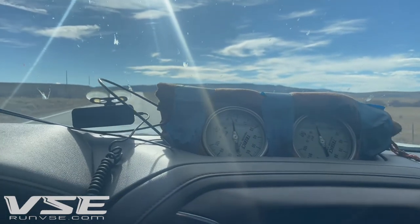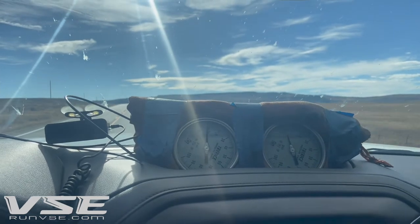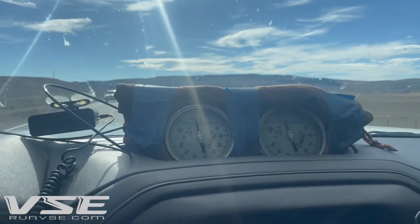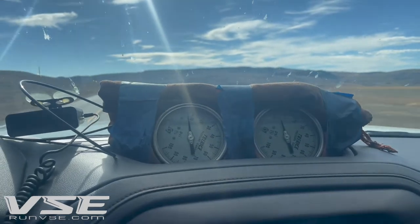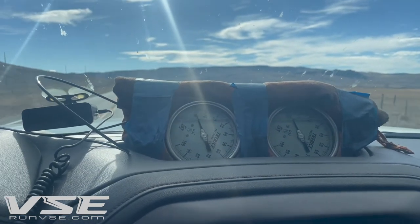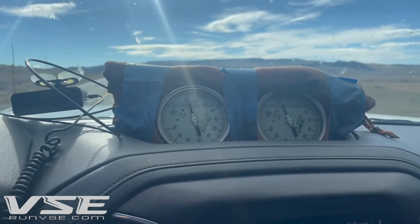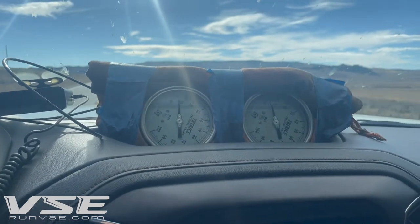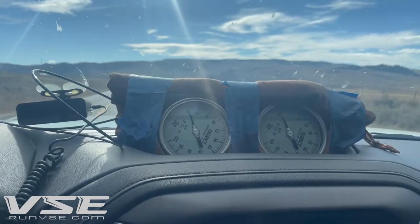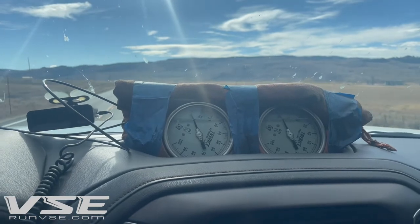With a fixed vane turbo you can get decent drive pressure, but they have a fixed AR associated with them. They're typically built loose enough to make good power only at the critical speeds where the turbo is efficient, and they have their own compressor map. A VGT turbo has a variable AR, and the AR relationship has everything to do with how far the vanes are open or closed. Right now the turbocharger vanes are sitting at about 60 to 65 percent. When you toe into the truck the vanes snap closed into the 80s, then the turbo boosts up to commanded boost and all is well.